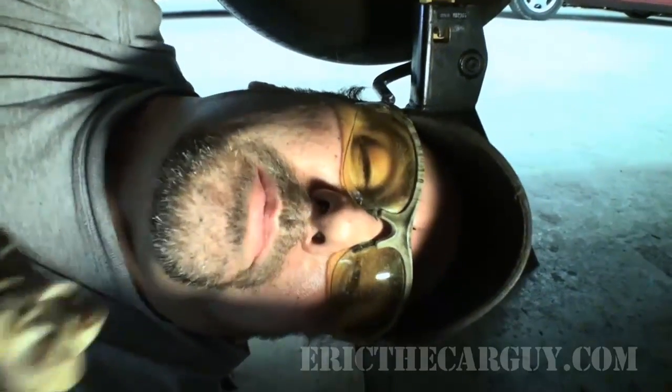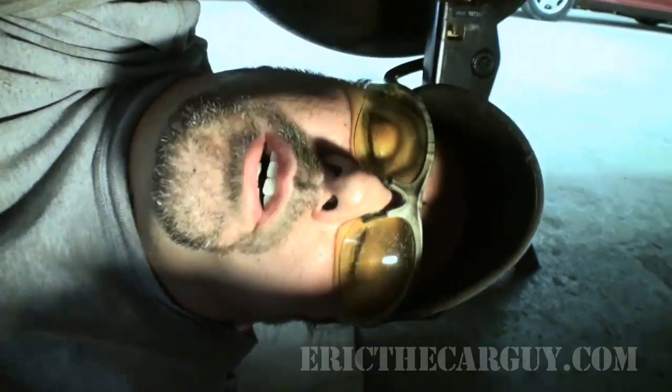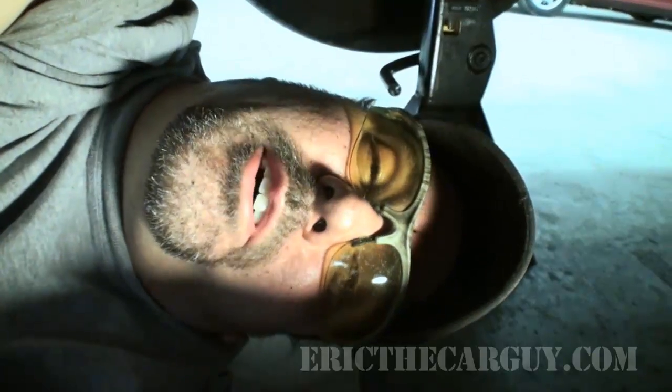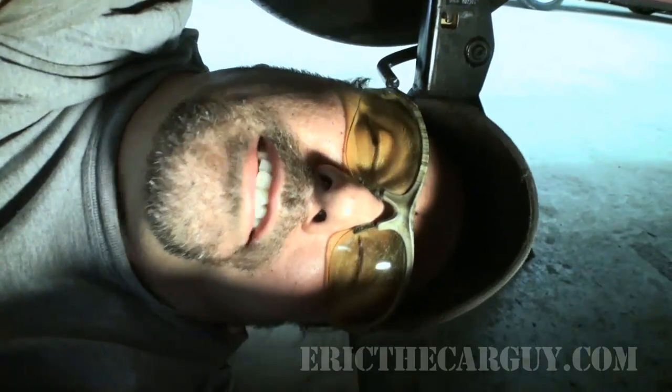And trust me, it's not uncommon for something like this just to go in there and move the wiper arm around to fix something like this. We'll get it all back together and then get a look at the gauge and see what happens, because we know, well, geez, we're down to about half a tank now that we dumped out all of that gas in order to get this sending unit out. So we'll see where we're at.